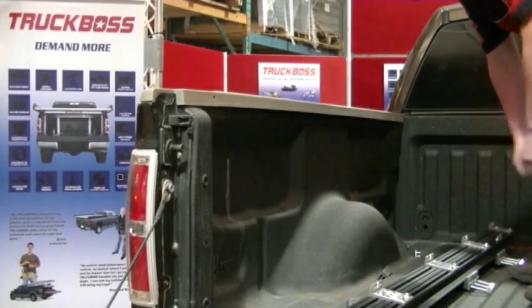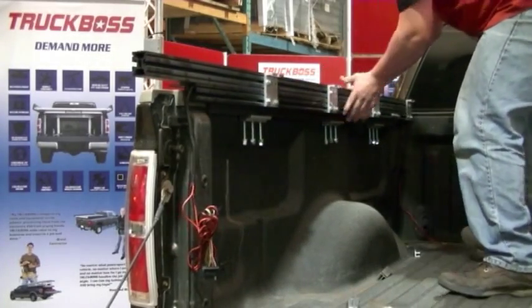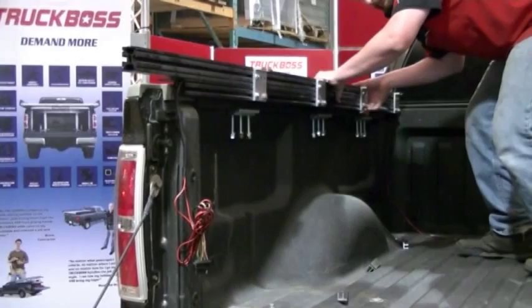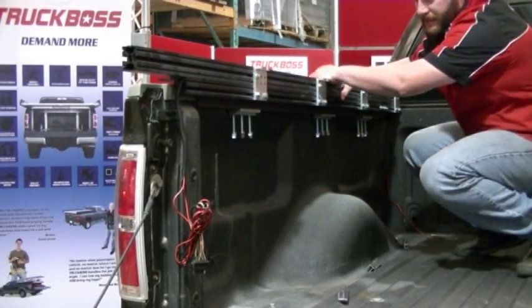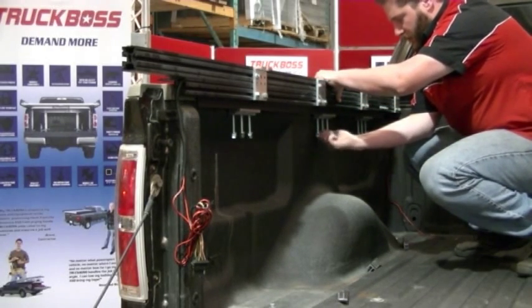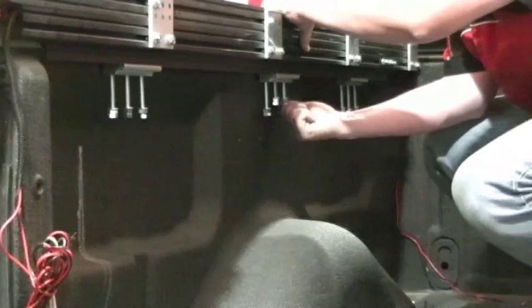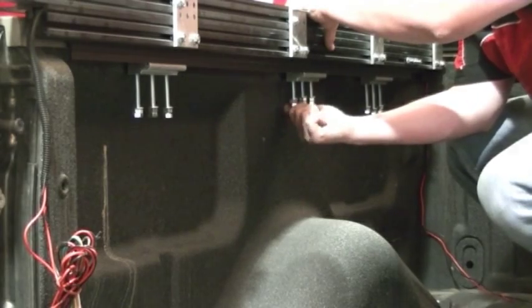We're now going to lift the full rail and rail capture assembly onto the driver's side. We'll place it so it's 1/8 off the front bulkhead. And we'll take our center clamp and line it up on the center. I spaced out my other clamps near the rear and near the front. They don't have to be exact, as we're not going to be tightening them down fully right now. So first we'll spin them up just by hand to get a few threads engaged on the clamps. This way we'll actually be able to hold the F-channel in place when we insert it.